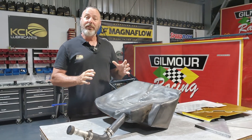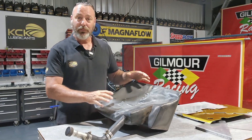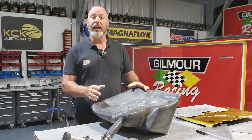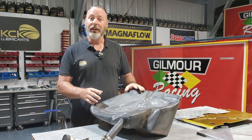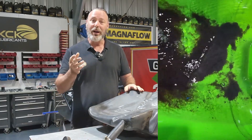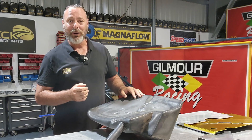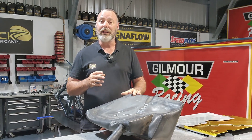We are just about ready to start fitting all these components into the car. But before we do, we've had to flush the fuel bladder out. As much as this bladder is better than the one we had with the car, it's still not perfect — it's been in storage for a long time and the fuel cell foam inside the bladder had come apart. So we've had to flush maybe 20 litres of fuel through this to get it clean. Here's a shot of what the fuel cell foam looks like when it comes apart — it's going to block up absolutely everything. It'll block up a filter in no time and will certainly block up the fuel pump and the carby. It takes a whole lot of work to clean out, so making sure this thing is clean now is a whole lot easier than trying to clean it in the car.